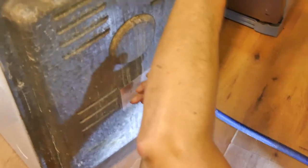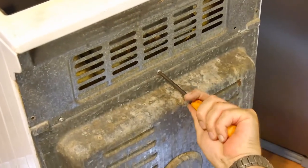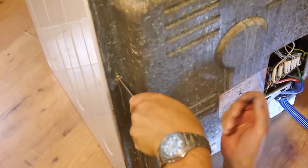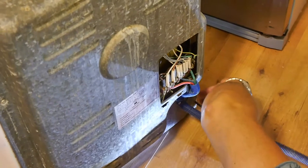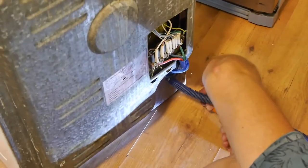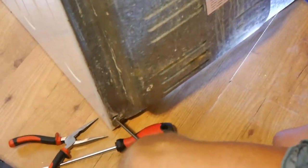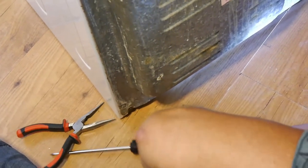And right, so we've got all the screws in now. We're just going to tighten them up. There's no sequence involved with this, unlike a car camshaft or a head. You just tighten them up like that. Once you've got them all tight, see, the thing is, if you fully tighten one or two to start with, you couldn't maneuver the rest of the cover, because it might be off just a little bit, enough so you couldn't get a self-tapping screw in. So it's a good idea, as I keep rattling on about, get all the screws started and then tighten them all up at the end.